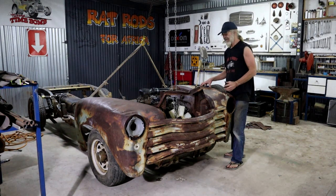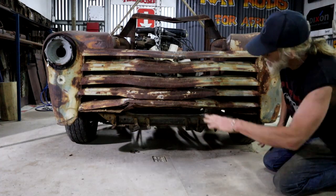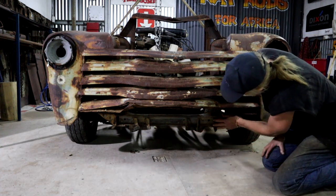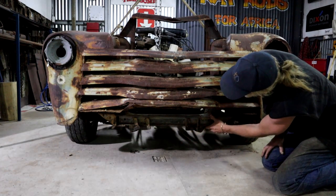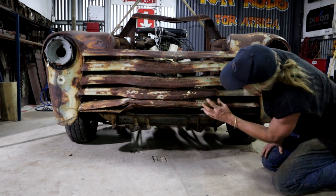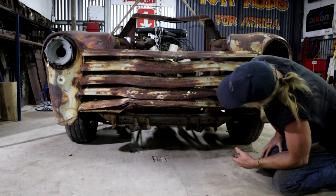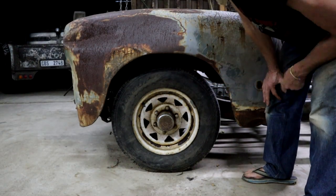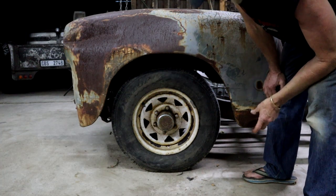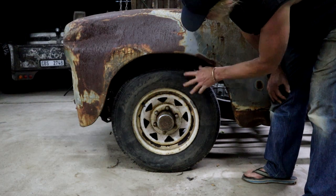Let's have a look at some of the other views quickly. From the front you can see it's more or less level now. The grille here is a bit bashed up, and the fact that I can see the frame or chassis down here I don't like too much. It needs to drop maybe another inch or so. When I take it off again I need to do a little bit of straightening and panel beating and fine tuning up here. The wheel is pretty nicely lined up in the wheel arch. You could argue it might have to move forward maybe an inch at most, but I think it's pretty damn close. The clearance here could be a little bit less - it'll depend on tire size.